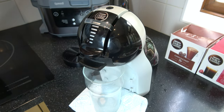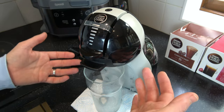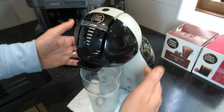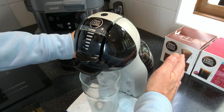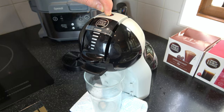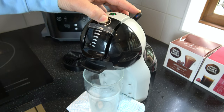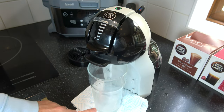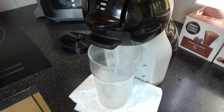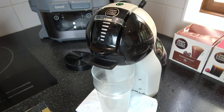So this is going to be the workaround - we're going to turn it off. Now we have put descaling fluid through it and you've seen it came out. So we have descaled the machine but we need to rinse it because it's not safe right now to drink coffee from it as it will still have descale solution in it. So we're going to put it into descale mode again, but this time we've got fresh water at the back so it's going to bring through the fresh water on a hot cycle. So I'm going to turn it back on again and hold it on for five seconds to go into descale mode again. Now I'm going to go to the right - and can you see it's fresh water but look at it because this is the remains of the descale solution coming through. So in a way we're kind of manually doing the descale process rather than allowing the machine to do it in the set way of doing it.